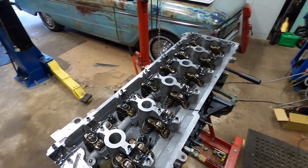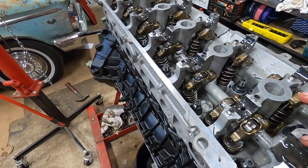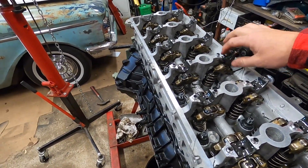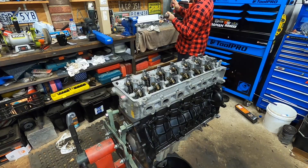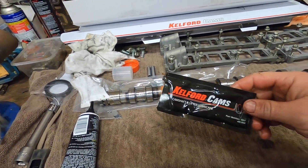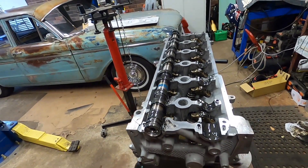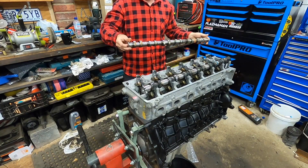The cam carriers have got assembly lube in them — just got this Penrite lithium-based stuff. Yes, it's freaking sticky and yes it gets everywhere. I've gone overboard with it; I don't really want to take any risks seizing aluminium — it would probably eat it up pretty quick. We'll coat everything in it. Got the Calford cams in — exhaust cams in here, intake as well. It turns out Calford actually give you a camshaft lift lube. I'll throw some assembly lube on the underside of the cam caps and bolt it down.